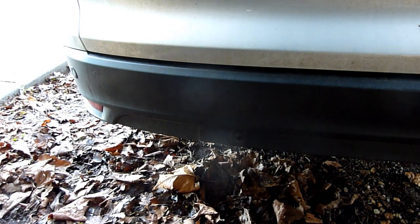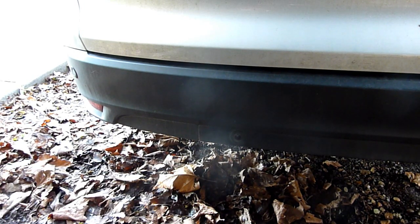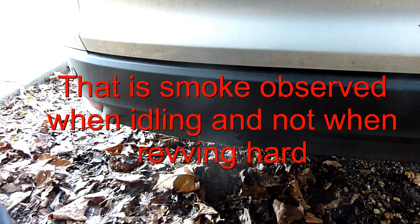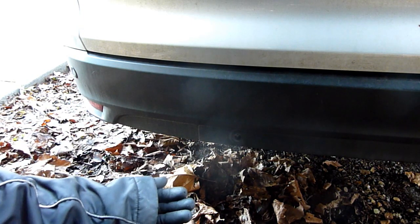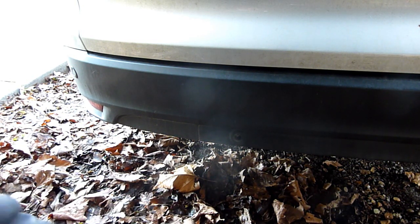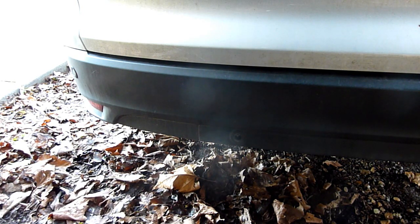One last thing I almost forgot: two weeks prior to your vehicle inspection, check underneath with the engine running — if you own a diesel in the UK, is there any smoke coming out? If your diesel car has a diesel particulate filter — cars after about 2012 to 2014 would all have had one — any sign of smoke is a failure, game over. It could be clotted-up injectors, a blocked diesel particulate filter, or all sorts of issues.